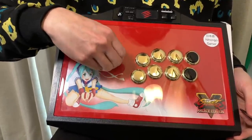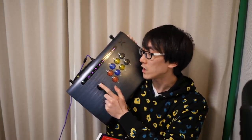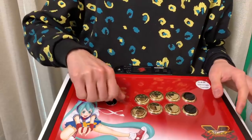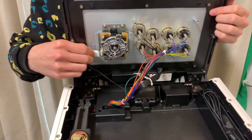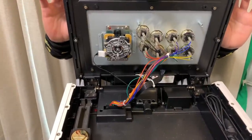The thing about the Victrix Pro is that if you stick with the Victrix Pro Link 2, you can't really change the ball top because you need a countersunk ball top — it's a special shape. So if you want a gold ball top like this one, you can't really use the Link 2. You'll need to use one of these Sanwa ones, but it's $20 to $30. Even if you buy Victrix, you can install any Sanwa lever in the Victrix Pro FS, as far as I know. There's a five pin connector here from the Mad Catz PCB — plug that there. And you are modified!